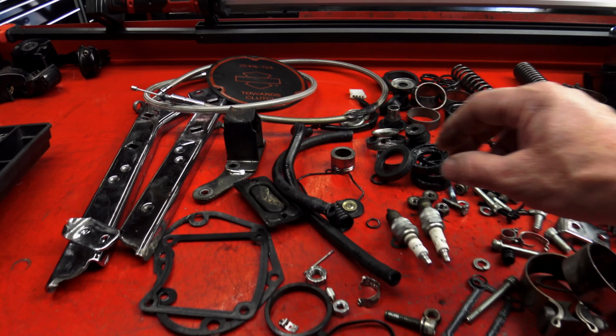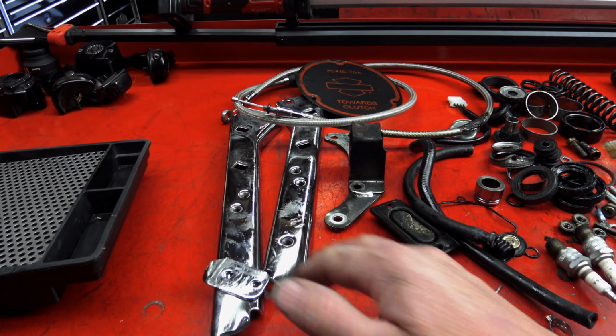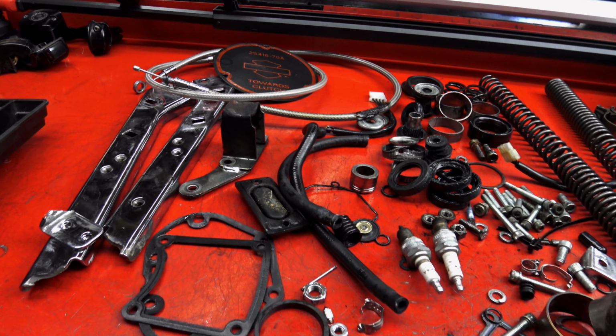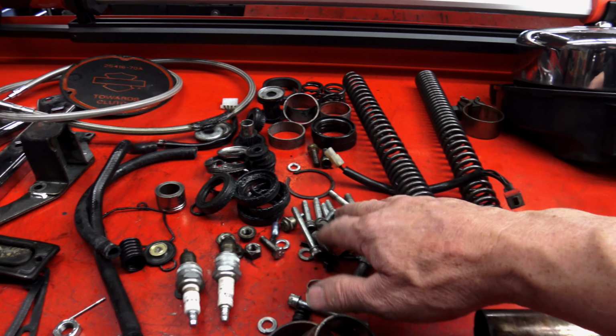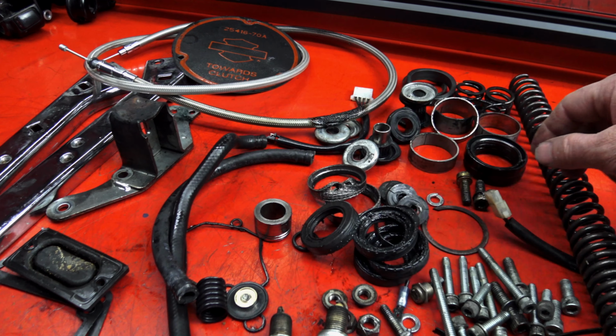But wrong wheel spacer that was installed, rear saddlebag struts that help support the rear mufflers. The clutch cable was burning through and leaking. It was touching the old exhaust pipe. This exhaust bracket we don't use with the S&S exhaust clamps. Assorted gaskets for the brake master cylinders, we flushed the DOT 5, assorted screws, wheel seals, handlebar bushings, exhaust gaskets.